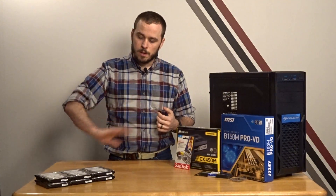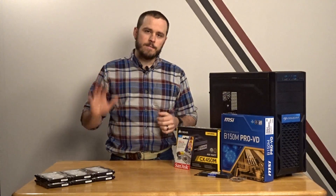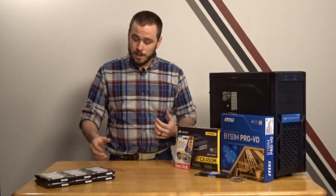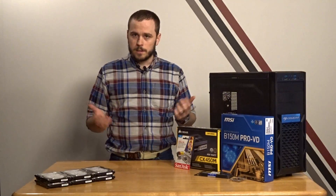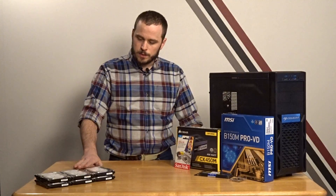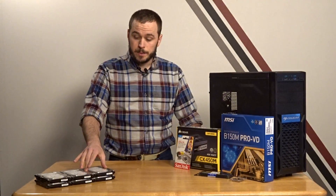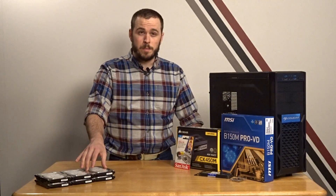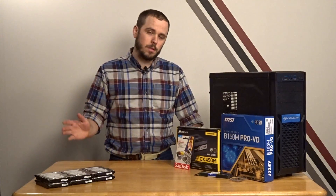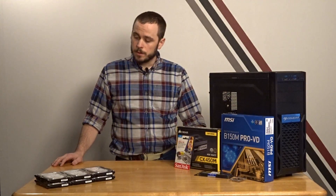I CrystalDisk'd all of these drives to make sure they were in good shape. Five out of the six drives had less than 10 hours powered on and one or two power-ons total — some had never even been turned on. One drive did have about 40,000 hours and several hundred power-ons, which isn't horrible for a video drive meant to run 24/7. That drive may fail sooner, but as we'll go over in setup, we're configuring it so even if there's a failure we won't lose data. I only paid about $25 each for these, versus the normal $50 to $60. You may not be able to do it quite as cheap — it could be another $100 or $150 unless you can find or salvage cheaper hardware.